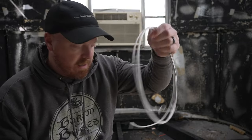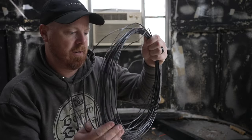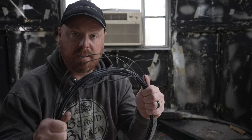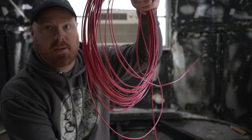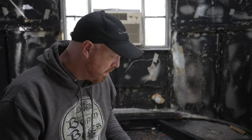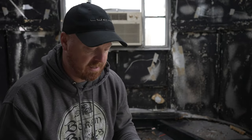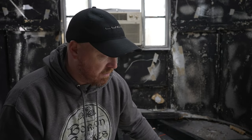Here's my ground wire. I was going to use this to run my side lights and blinkers, and then this is for my tail lights. You may be wondering why I only have three wires if I was planning on wiring up a four-pin - it's because I doubled one of them. My local hardware store did not have the colors needed, which didn't matter as long as I've remembered what goes where. I'm going to label them with a piece of tape - the black was my ground, and then my green and yellow was one, and then my brown.